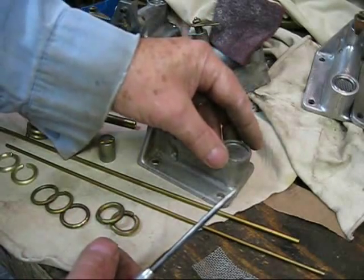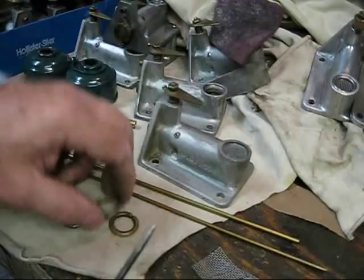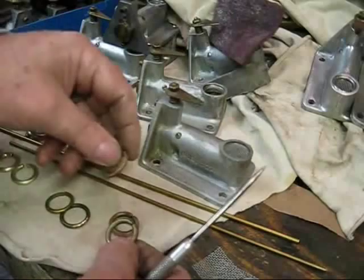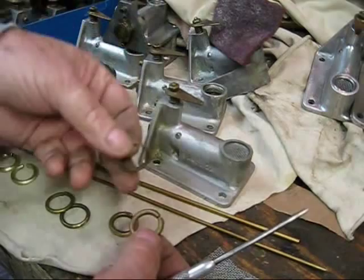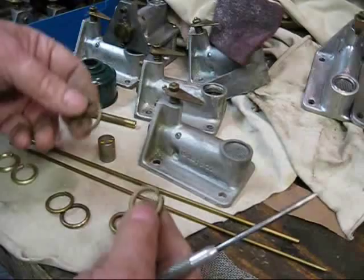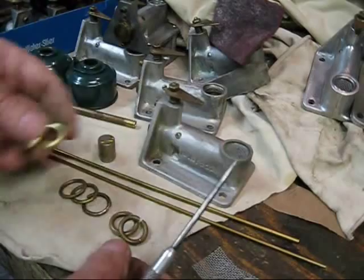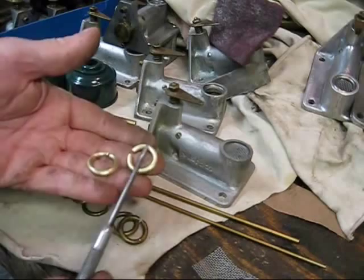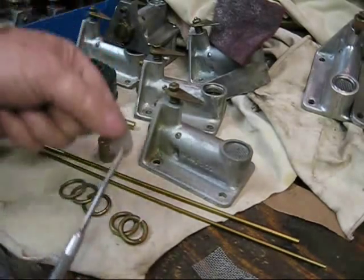The screen went in the mixer opening and had a snap ring in it. There were two sizes here on the workbench. This one is 5/32nds, this one is 1/8th inch material. Both appear to be original Maytag — I disassembled them out of Maytag mixers. What I'm doing today is making the snap rings plus the screens to go in the mixer.